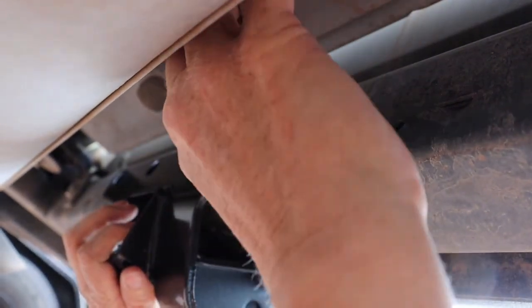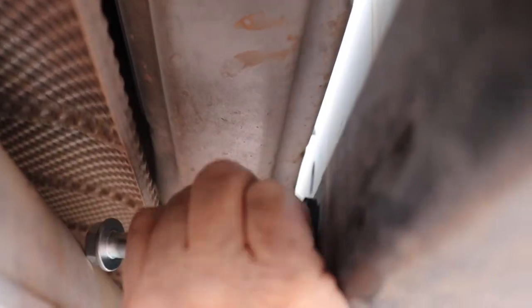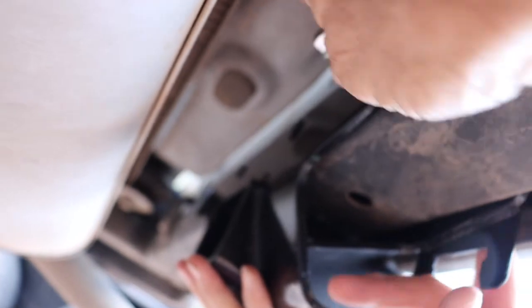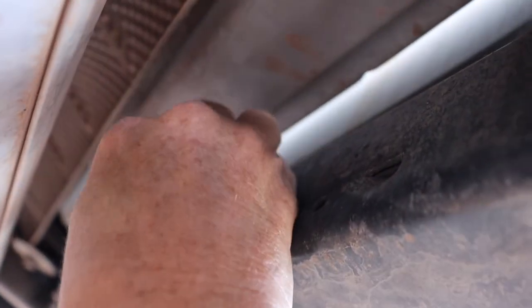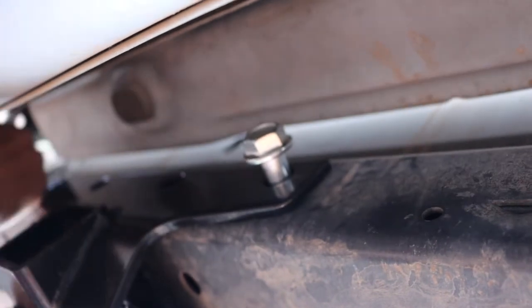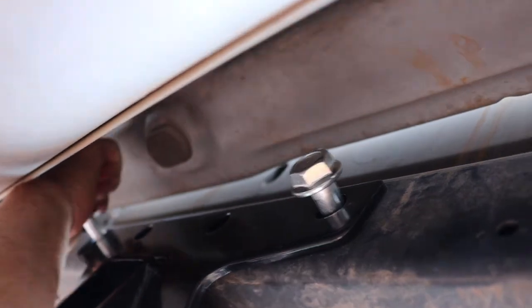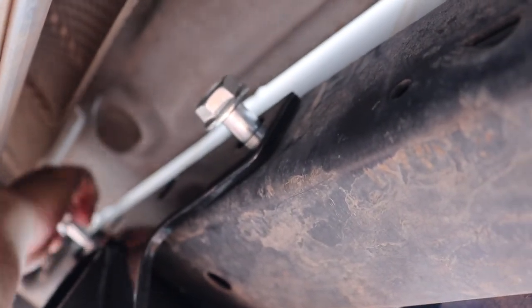Here's a bolt. Get the first one lined up — you're going to have to go over the top of the muffler here. I started it a little bit, I really don't need to leave my hand here because it's kind of on there already. But the trick is to get it through the nut — you got to wiggle it around some. We got the first one in there, we had to do a little finagling. I think Jill's going to go ahead and get the rest of them in there, and we'll be right back.